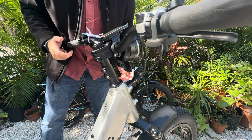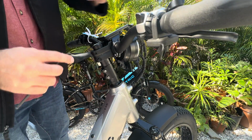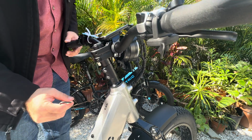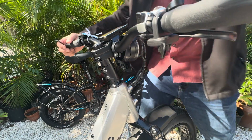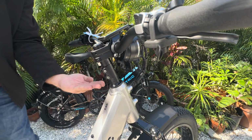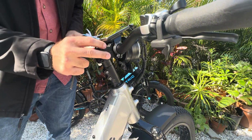So this is the point where you want to start paying attention to the alignment of your handlebars with your front wheel. Make sure it's very straight. We'll get this decently tight on there, and then use some of the friction to make the final alignment for the straightness. Make sure that the bike wasn't picked up so none of your components are out and the spacing's not off.